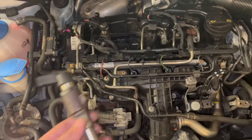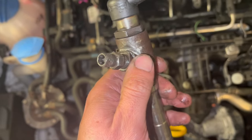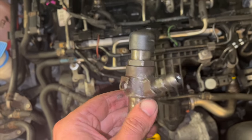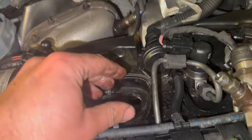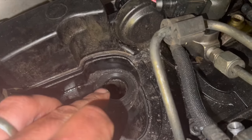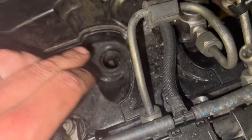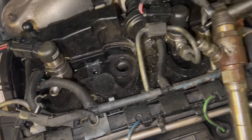We're back on the job a few days later. It took quite a bit of work to get that injector out — the best method was using the air chisel, knocking it back and forth, though it did break the injector clamp. One important thing: as you pull the injector out, be careful not to drop anything into the head. There's no tube around the injector in the rocker cover top, so any bits of metal that fall in could easily cause engine damage.